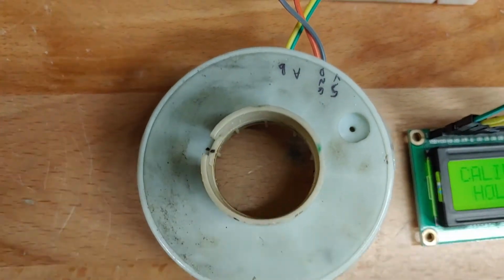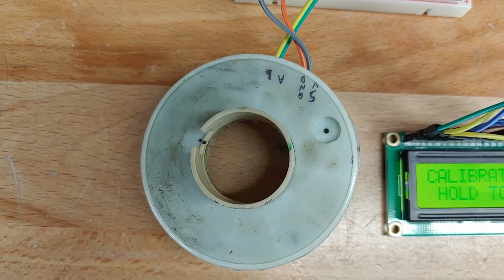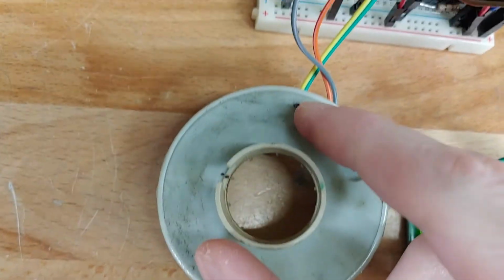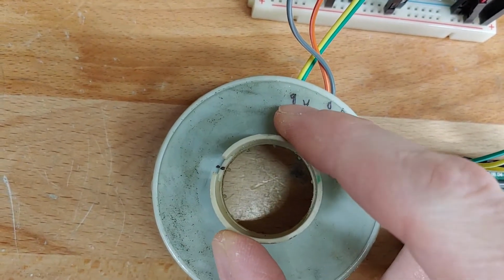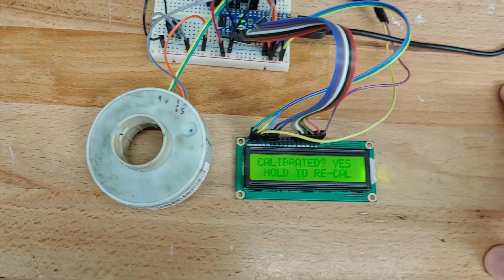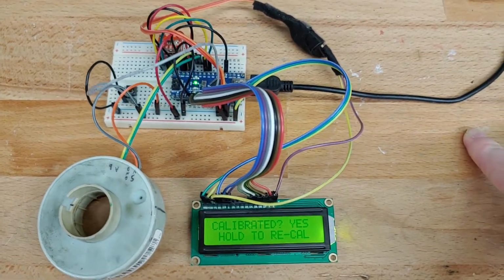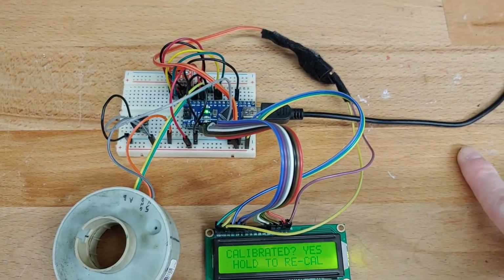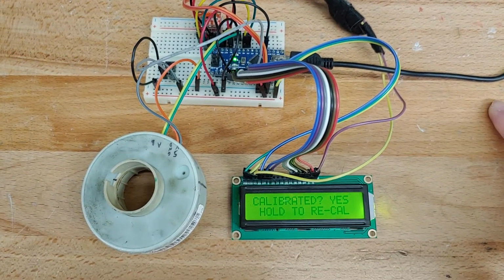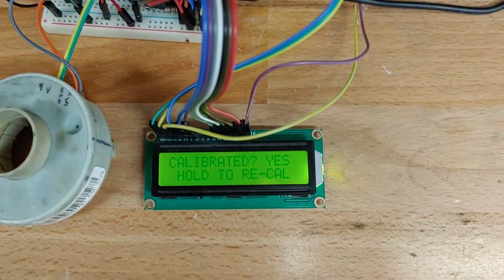And then just a quick overview on this. This is the sensor from a 2003 Z06. And these two dots are supposed to represent if the steering wheel in the car was centered. And so I got it pretty close. Ultimately, it's unlikely that the sensor in the car will be perfectly centered, and so the calibration is intended to overcome any misalignment between the center of the steering wheel and the sensor itself. So now we've got the device calibrated. We're good to go to start playing around with it.